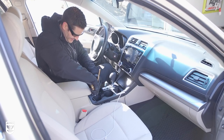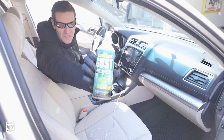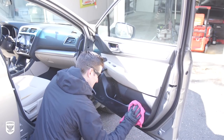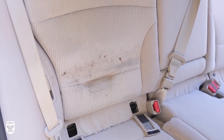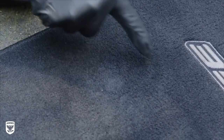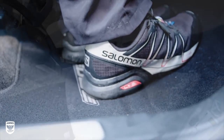If you have compressed air, use it — air is your friend here. If not, use a computer aerosol duster for the vents and tight spots, or just skip it altogether. After the cup holders, switch to the passenger side door and work the other two doors if you have a four-door. Next, locate any stains on your seats. If you have leather, use a specific leather cleaner. If you have fabric, alcantara, or carpet, use a specific fabric cleaner. Avoid using any all-purpose cleaners on these types of material. Here's a link to a video explaining why those types of cleaners should not be used on your interior.